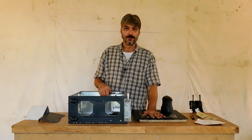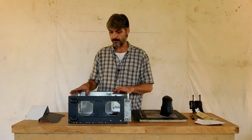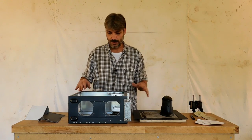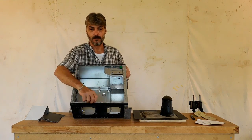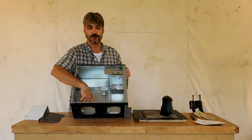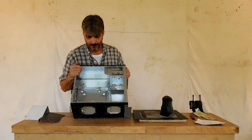The final will be done in 220 when it's all ready to be finished, the sanding. But I'll scuff it up and I'll use 180 on this galvanized. This galvanized metal is not going to want to paint very well. So I'm going to scuff it up real good, and I'm using a self-etching primer with zinc in it so that paint will stick to it good.